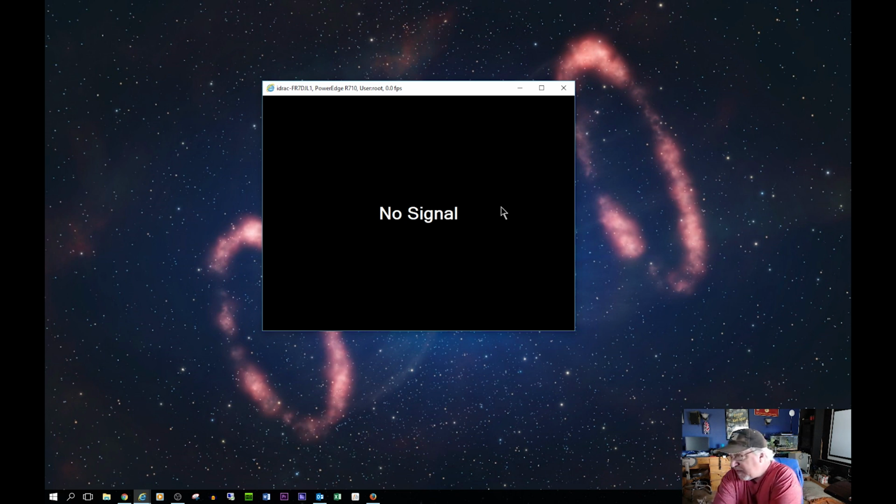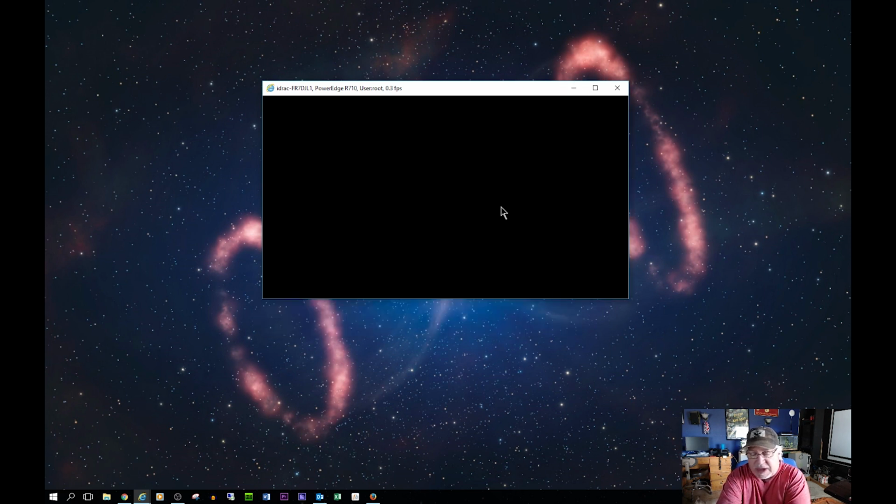Now what I've done is I've got 5 1 terabyte drives in here, a mix of Western Digital and Hitachi and a bunch of other drives. So what we need to do is go into the configuration utility and set these all up as standalone drives. I've already done that with the 2 1 terabyte drives that are in there, but I got a couple of Western Digital Blacks and a Hitachi in there. I want to set them up as well, and then we'll boot into Unraid and see if it even recognizes the drives.